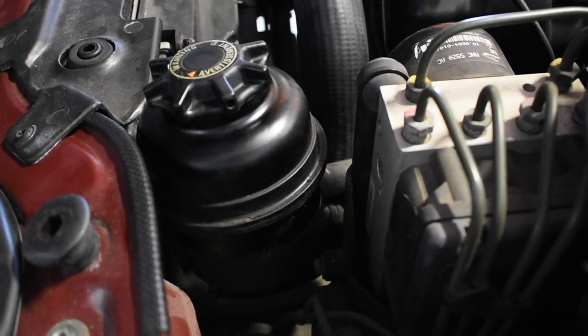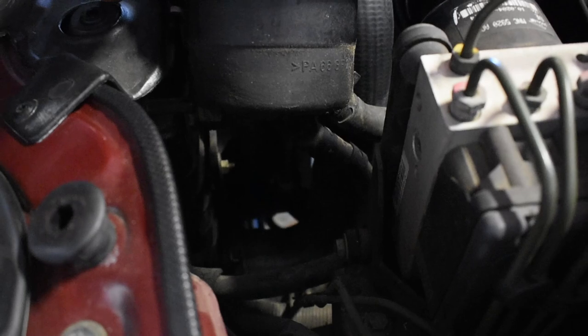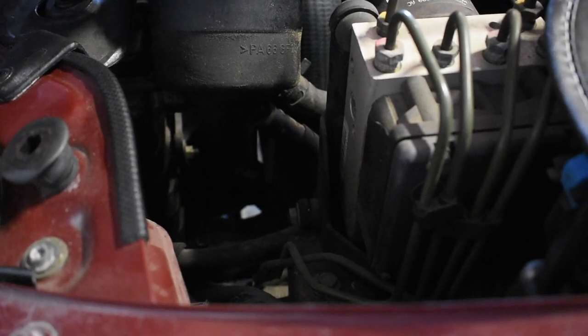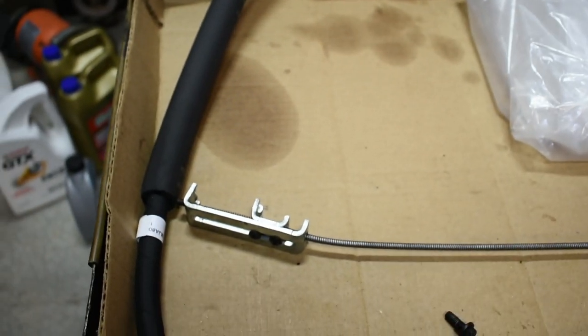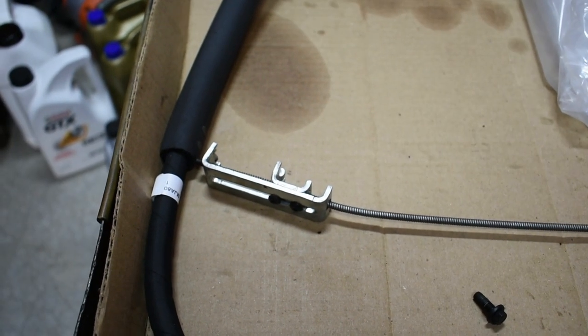I started taking the cooler off and got the passenger side off with the quick connects. Now I'm over on the driver's side. What we've got is two hoses on here — one to the pump and then one through the cooler, and then it comes back around to the other side of the pump. You've got a smaller line here — that's the lower line — and that's the actual cooler line coming back up. It's got a quick-release clamp. I use a special tool to get that off because it is in a very tight area. I would suggest getting one if you plan on doing this kind of stuff — they come in very handy for really tight areas.